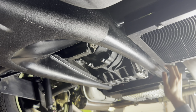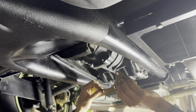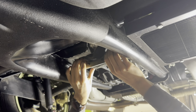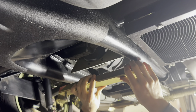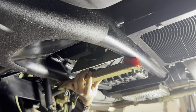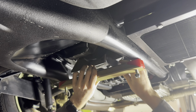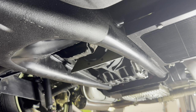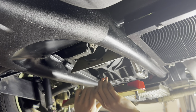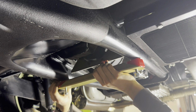This is the cleanest underside of a car — and without fail, we'll get something in my eye laying underneath it. So here's my main brace that connects to the transmission, and here is the part that goes against the horns. Here is a strip of metal that's about one-eighth inch thick that I cut. This one's perfectly against it. I have one where the horns would be perfectly against it and one where they'd be a little close. I was also thinking about shaving the insides of these red bushings just a tiny bit, so they hug the horns a little more instead of having just one specified point of contact in the middle.